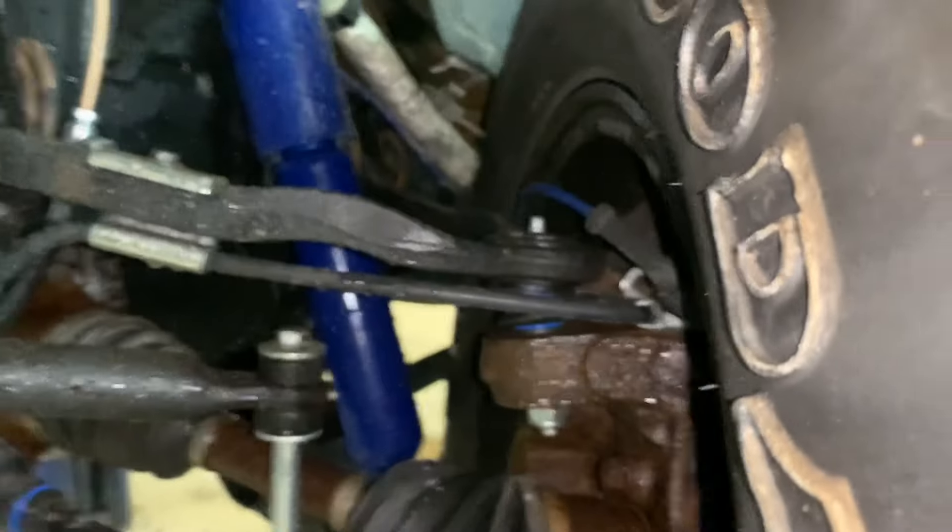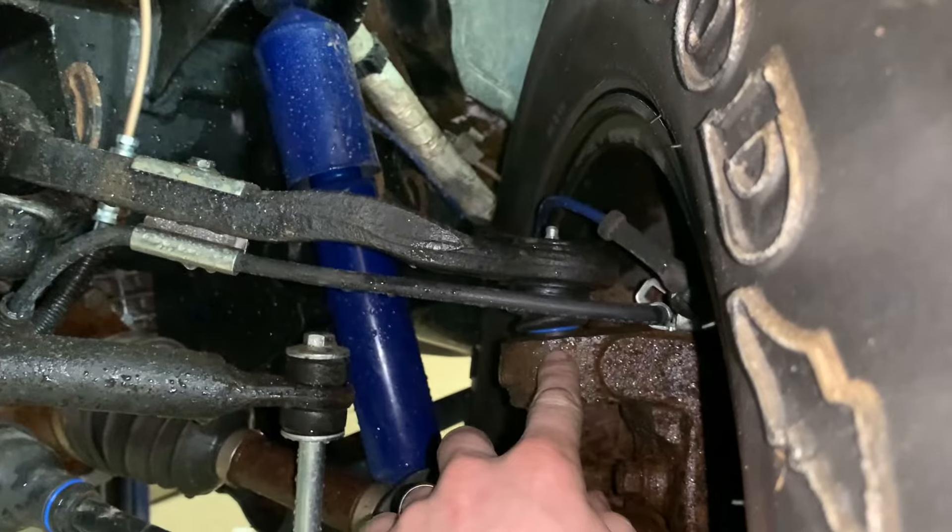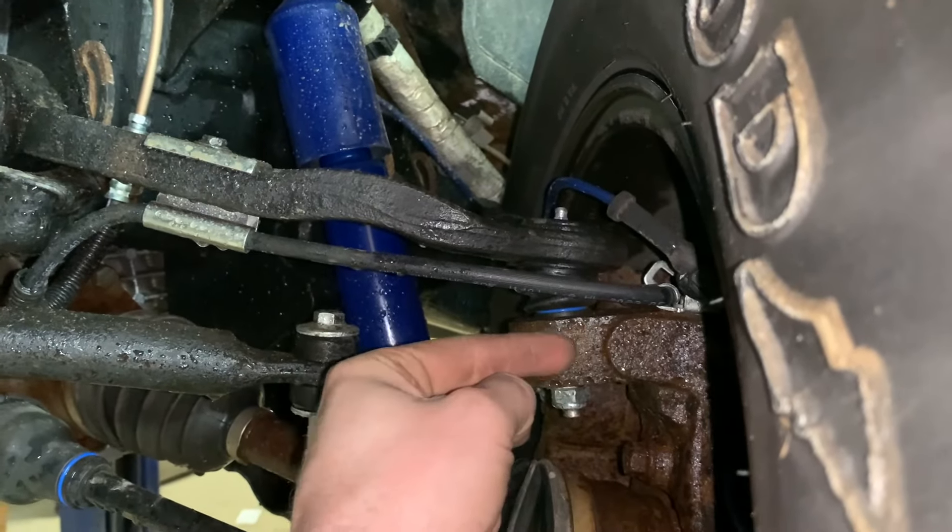I wish I could give you a visual of it, but I can't get under the truck when it's lowered because of how low it is. But the knuckle is level while the control arm is tipping up big time, so I'm going to flip the control arm over so that hopefully the angle where the ball joint is sits a lot more flat. When you get a lower truck, my CV axle is actually pointing upward from the diff out to the wheel. Right now the knuckle and the upper part of the control arm are just about parallel.